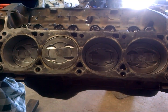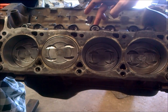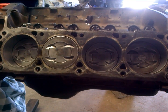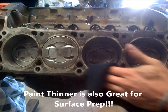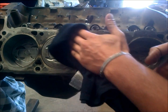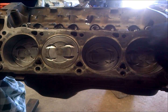Now that we got our lifters all in here, pushed all the way down with our high pressure assembly lube on the bottom, they are good for the camshaft break-in. What I'm going to do now is clean all the mating surfaces before we put the head gaskets on. Just going to use a standard carbon choke cleaner, get a nice coating on a rag, and run around that mating surface to get all the oil and greasy fingerprints off. That's real important to sealing the head gasket, or any gasket for that matter.